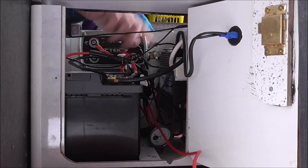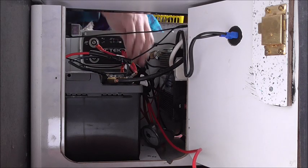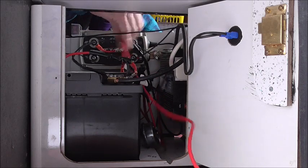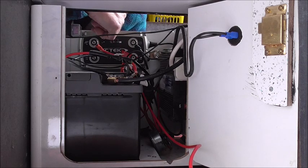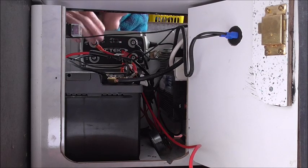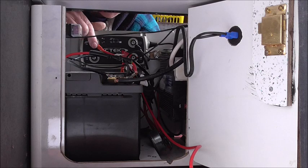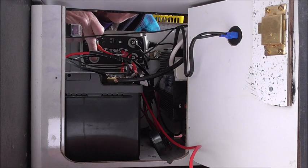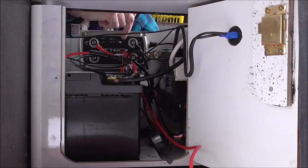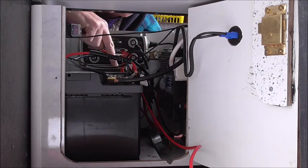Connecting up is relatively simple. From the van battery, from the relay, we have first this main cable coming through that you've just followed underneath the van. It goes straight into the CTEK and the relay. Connecting it into the CTEK — because it's a smart alternator — we're connecting it into the port that's normally used for solar panels. If it were a standard alternator, you'd connect it into the bottom one that shows an alternator symbol on it.